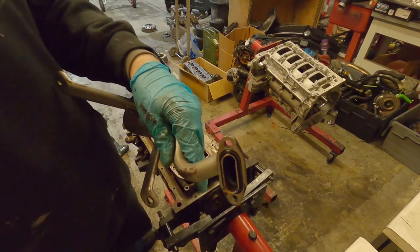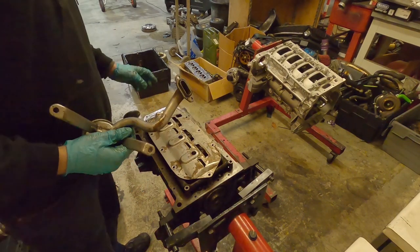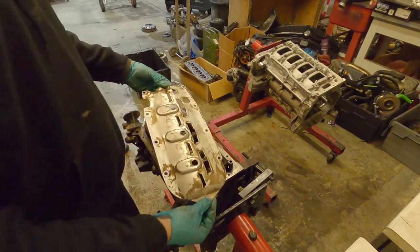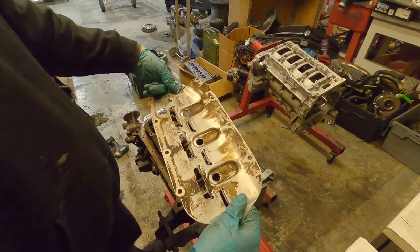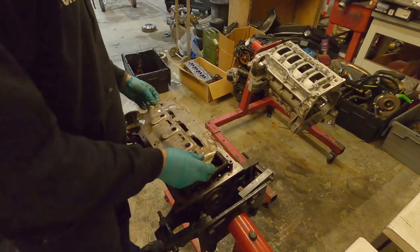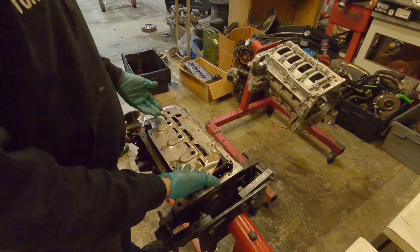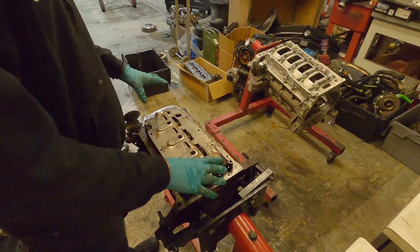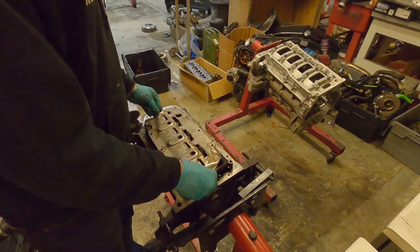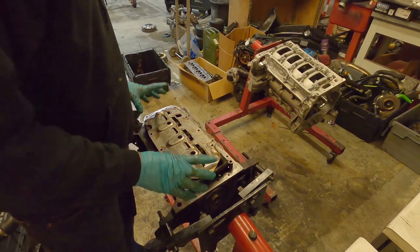You need to take this seal off and put the new one in from your gasket kit — so change all your seals as you go. This stuff looks a bit grubby but it's actually been dipped and soaked for 24 hours — it's just leftover oil residue. We've washed all the loose dirt off. We're more worried about any dirt in the engine than oil staining. Make sure you wash things but don't get too worried about the oil stain. Now we know where we need to put our bolts — get the bolts, change the seal, put our oil pickup on, and we can get the sump gaskets on.